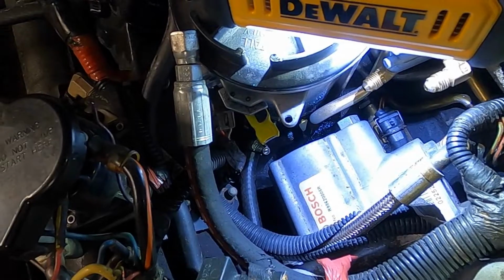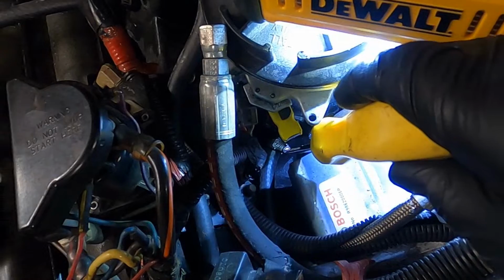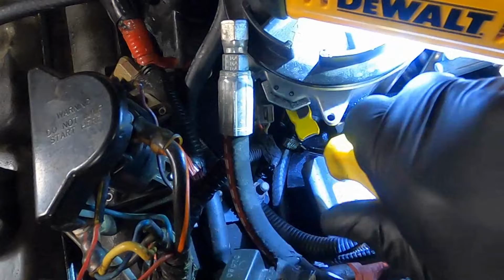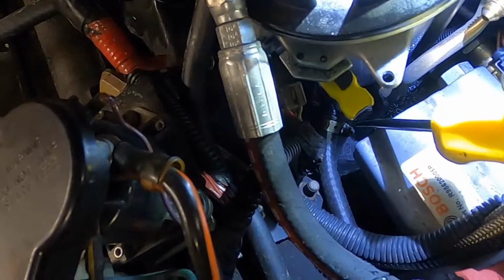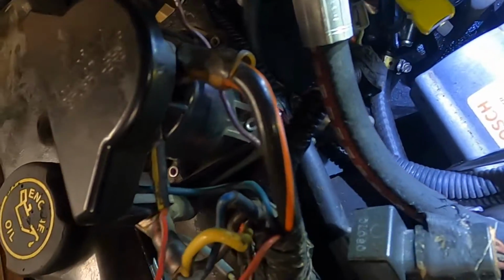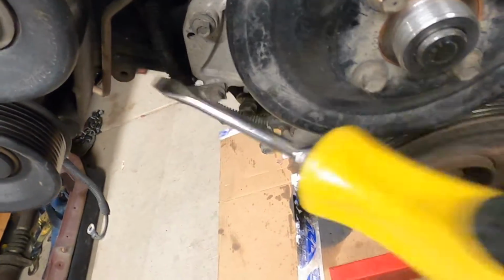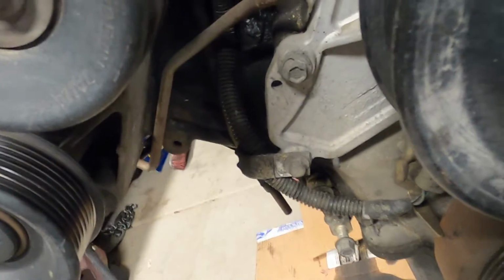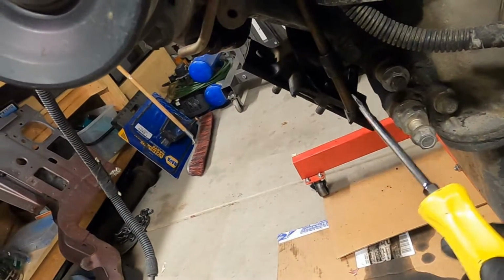So one thing I should mention here, with our fuel bowl, down here we have this hose clamp that goes to the little hose, and this is actually the drain hose for that fuel bowl. So now this line actually snakes its way off of this drain, goes back in through here, and kind of disappears back here, but it goes to this line here, which I really don't think you can see very well because it's quite greasy. And then it just drains right here.